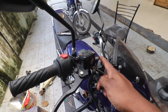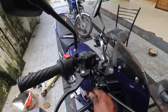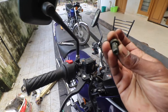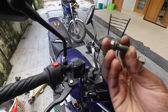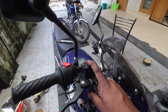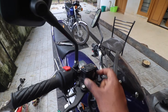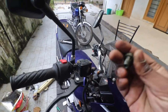The fluid squirts out of these openings and goes into the brake hose. Sometimes what happens is this banjo bolt gets blocked. This can happen over a period of time if you don't use your bike regularly — something might get stuck in it. Also, brake fluid has another issue: it absorbs water. When that happens, there can be corrosion which can block it.